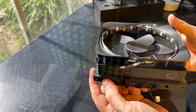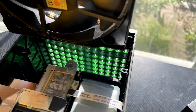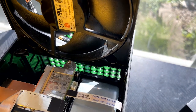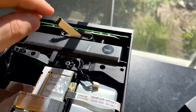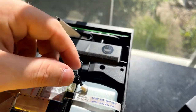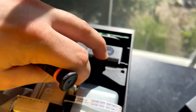Now we have our console again. Grab your fan shroud and make sure when you put it back in you're lining up the indentations on the fan shroud with the little rails on the side of your console. It mostly lines itself up, so just slide it on in. The important thing to note is that our black wire and our LED wire are both in the back — go ahead and plug in that wire and give it a nice little tug just to make sure it's not going to come out.